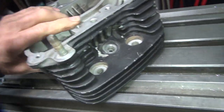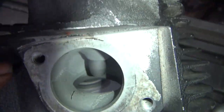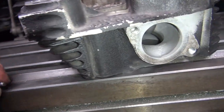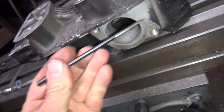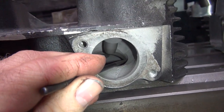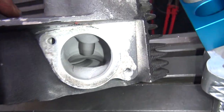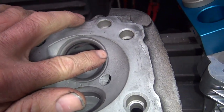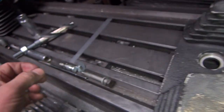The other problem is underneath the port is something else — it's called the valve seat. So if you're coming down right next to the edge of that port with too much angle, you want to make sure you don't go into the seat. Remember the seat is a lot bigger than what the diameter of the valve head is. The seat goes way into here and then you've got to have metal to hold it in — so by the time you're this far over, you're getting close to poking through.